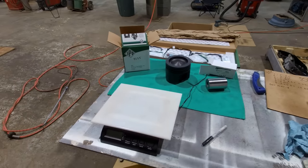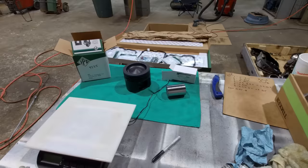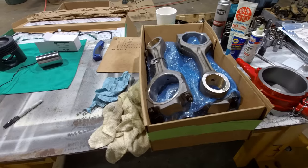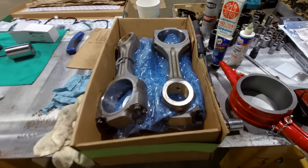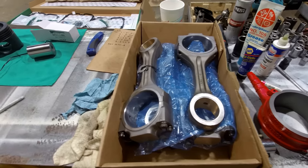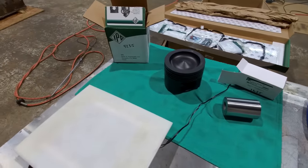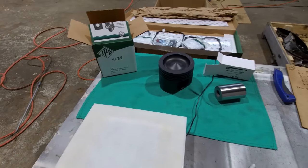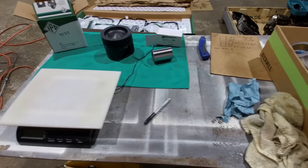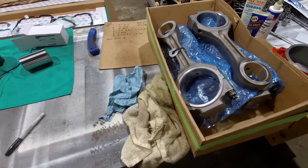I'll also look at companion cylinders and where each one is at in relation to each other. I've had some people comment that this is not how you balance an engine — I'm well aware of that. This is a heavy-duty diesel engine; this is not something that's called for in the manual, and not something that 98% of guys who put these engines together even do. This is just something I do to get everything that much closer than it normally would be. I'm well aware that this is not how NASCAR balances their engines. Let me get everything weighed up and lined out and I'll show you the assembly of one of these rods and pistons and one of them actually going into the engine.